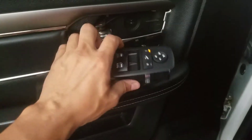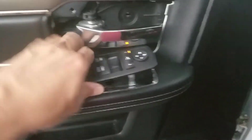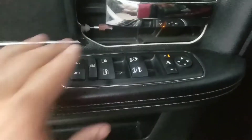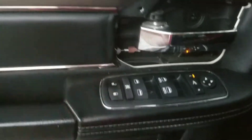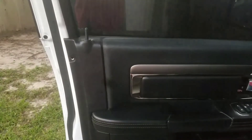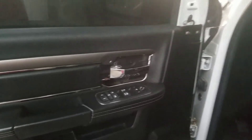Pretty simple install. Once you get it in, you'll see that the connectors will rise just enough for you to be able to get that switch in there. You see those little metal tabs there — pop it down. That works. Right as rain. So I'm going to finish buttoning this thing up and I will show you the results of a window switch replacement.